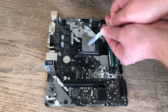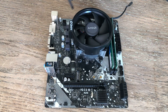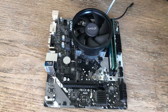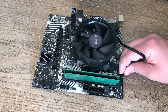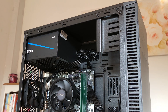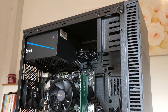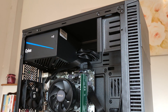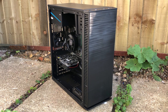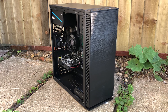If you buy a 3000G you won't get a cooler like this — you'll get the small form factor square-shaped cooler. It's noisier than the Ryzen stock coolers but it does still allow for overclocking, although an A320 board wouldn't. This build was for a bit of fun, so throughout the remainder of the video I'll be talking about what I'd actually recommend instead. It's the Ryzen 3400G, maybe even the 3200G with their respective integrated GPUs, or the Athlon 3000G's iGPU would also do okay if you wanted to use it before upgrading to a discrete graphics card.